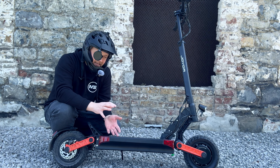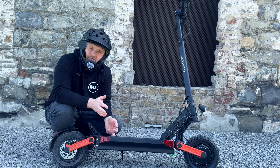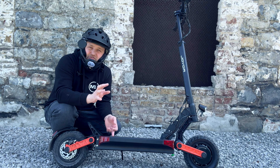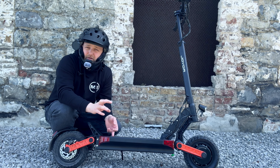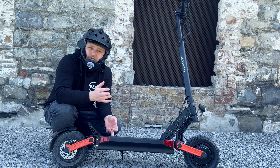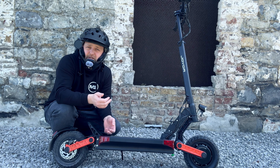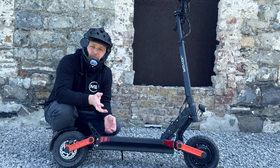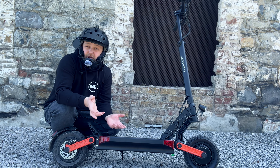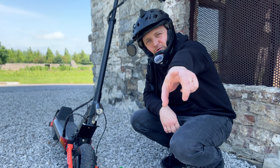As far as value for money goes, I think it's worth what they're asking. Keep in mind the suspension is firm and once you go over 50 kilometers an hour there's a tiny wobble, but that can be solved easily by changing the P-settings on the display — there are videos on YouTube about that and it only takes a minute. You can also speed-restrict the whole scooter through the P-settings, so if you live in a country where the speed limit is 20 or 25 km/h, it's a piece of cake. If you enjoyed this video please give it a like and subscribe.